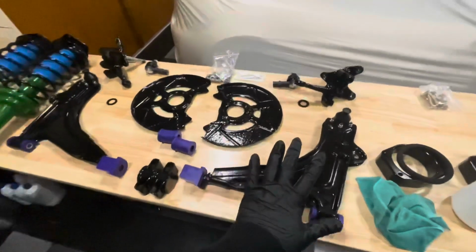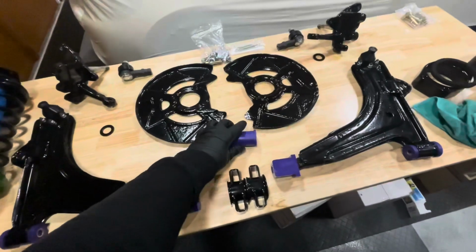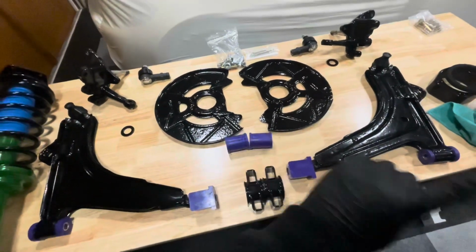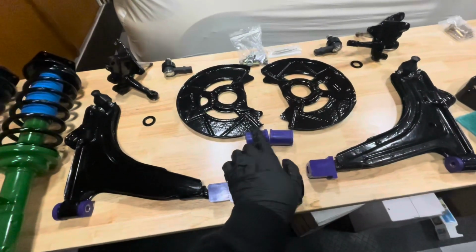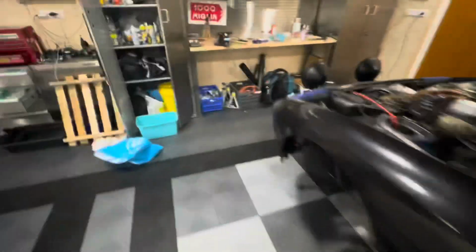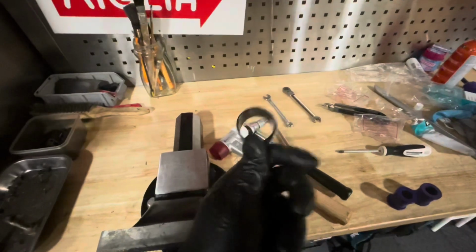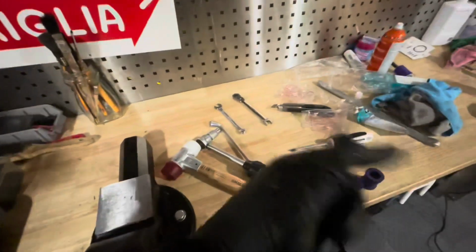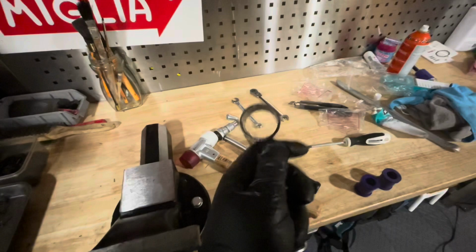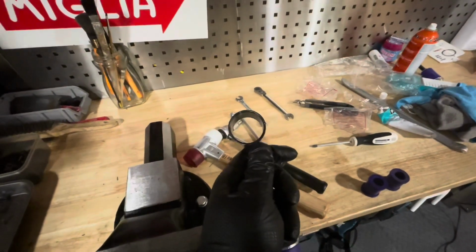All right, so now I've got the two A-arms completed as well. So these two bushes go onto the anti-roll bar, but I still need to take it off the car because I haven't done that. So we'll do that in a second. But I also have these drop links already refurbished, as you saw in the beginning of the film, but I need to push in the bushings through here. So let's quickly get that done. And once that is done, we'll go under the car and dismantle the anti-roll bar. And I think I might want to take out the cross member as well to get that cleaned up and sprayed.